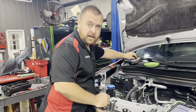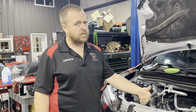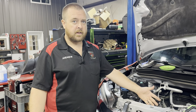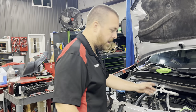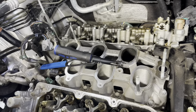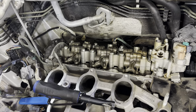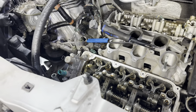Just a little side question — if we've got any Honda techs or Honda dealer techs on here, I have heard that the newer 2022 or 2023 Hondas have gone away from this rocker arm design. If anybody knows any truth to that, please let us know. Obviously, to do a valve lash adjustment on any of the Hondas with the V6, it requires you to pull the intake plenum off. We've got that all off. I went ahead and did the back bank off camera, so we're going to go through and adjust cylinders four, five, and six.